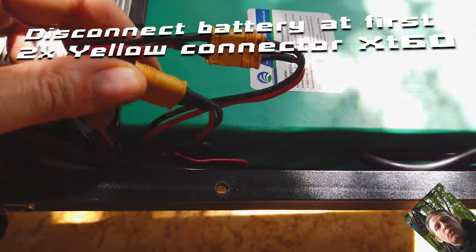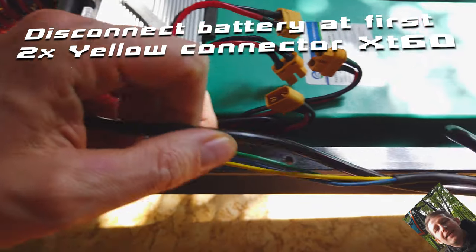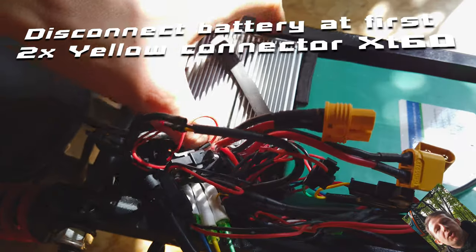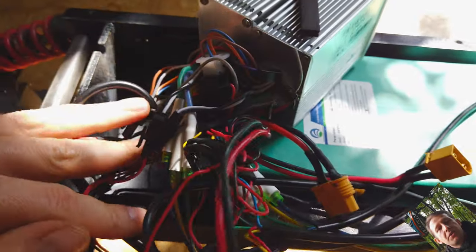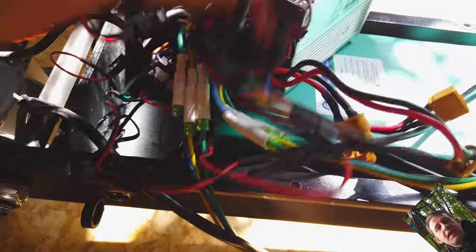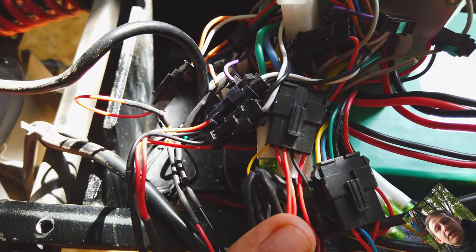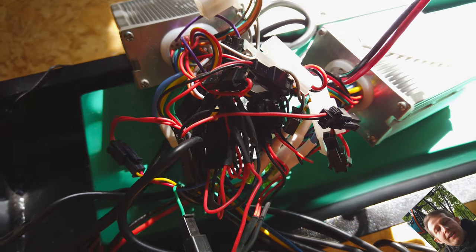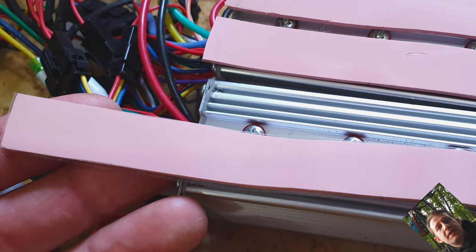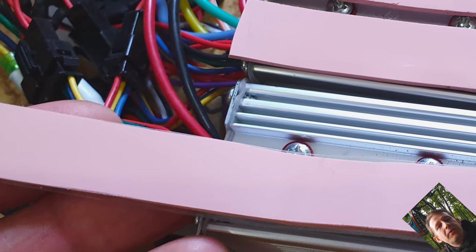Next super important tip: you have to cool down the built-in ESCs. The ESCs are these two silver boxes inside the deck — they give power to the motor. As you can imagine, lots of volts and amps go through them. Those ESCs are not connected to the deck to spread heat, and the number one killer of electronics is temperature. But we can easily fix this — just buy some simple thermal pads like from PCs, as you can see now. In my case I use 3mm thickness, but something between 2 and 4mm will do the job. Just place them over and under the ESC and close the deck.